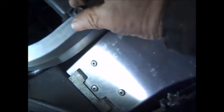You probably had to undo this bracket that holds the battery, so make sure you put this bolt back in right here — it's a little vacuum fitting that goes to the airbox. Put the 10-millimeter bolt back in and tighten it to manufacturer specifications; you don't want it coming loose.